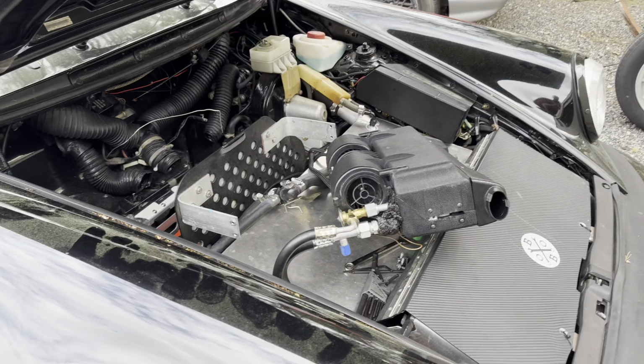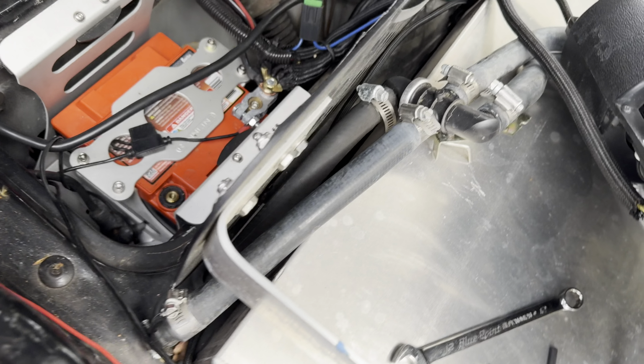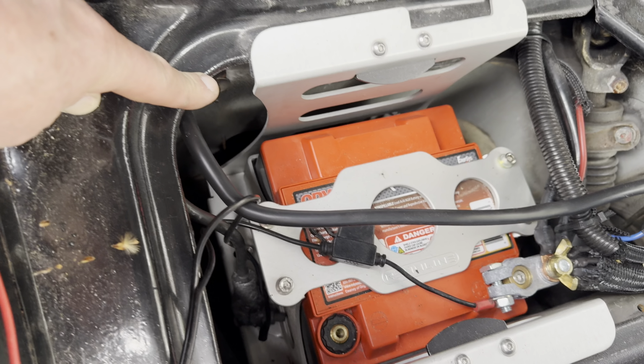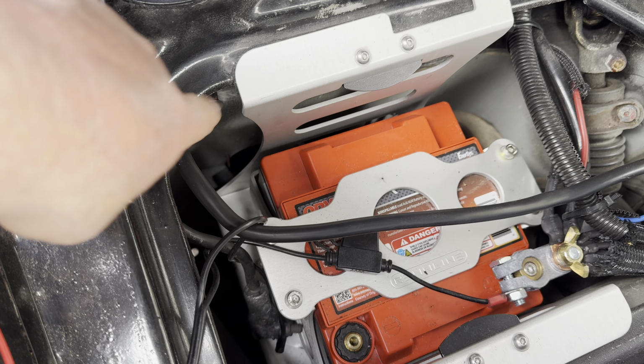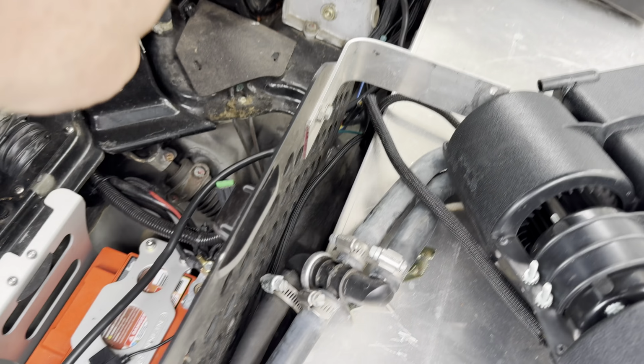Whoops. So, I'm gonna get back on time lapse. One more thing, guys. So what I also did, I relocated the battery there, and there's a stud there. I forget what that's for. So I cleaned it up and I put the negative cable in there. Well, I was thinking, this all started afterwards, so maybe that was my issue. Maybe it had a bad ground or something. Well, then I got this 4-gauge cable and I hooked it up there with the battery one, that I ran to an actual ground over behind, down over there. So I ran that cable there. Still the same issue. So with that said, we're gonna go ahead to the back.